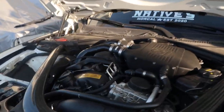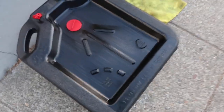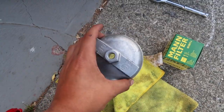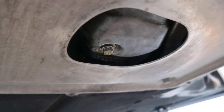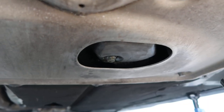Let's go into the engine bay. Please don't mind the dirty car — we've been struck with wildfires here in California. The materials you'll need for the install: a drain container or catch can, a rag, the BMW oil filter housing cap, oil filter, a ratchet and a 13mm socket, as well as your oil. You have to get under the car and slide the oil catch can underneath, then locate the drain bolt.